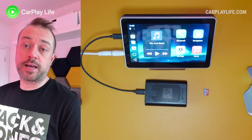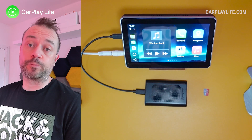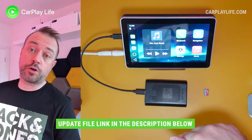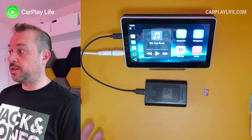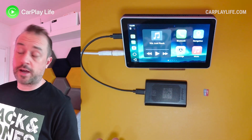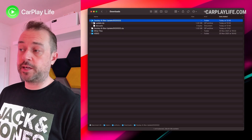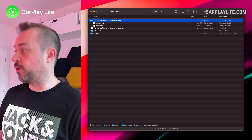I've got a guide for you today on how to get the download and how to apply it onto the dongle. First, you need to go to a web address which I'll put in the notes down below. Click on that, it'll take you straight to the zip and it'll start downloading. The zip is 1 gig in file size, so make sure you've got enough storage. Then we need to unzip the zip file. You can do this on Mac or PC - you've got two files: the update.zip and a box.auto file.